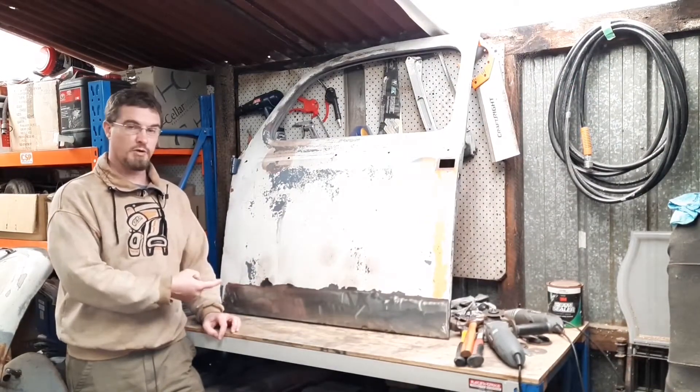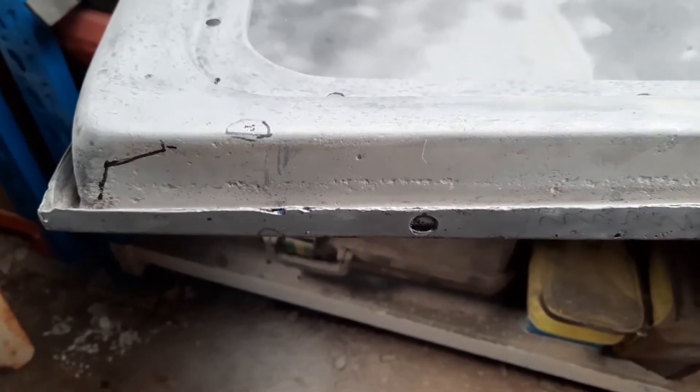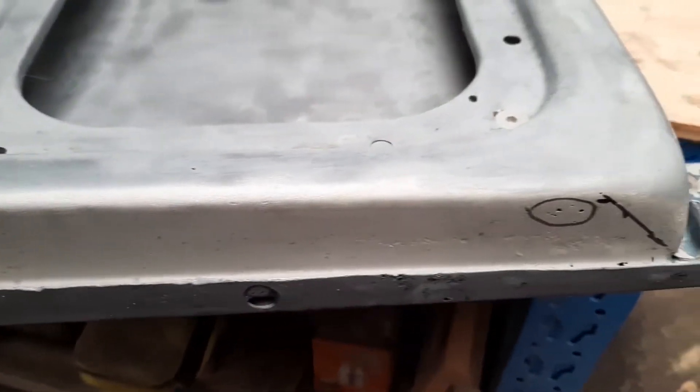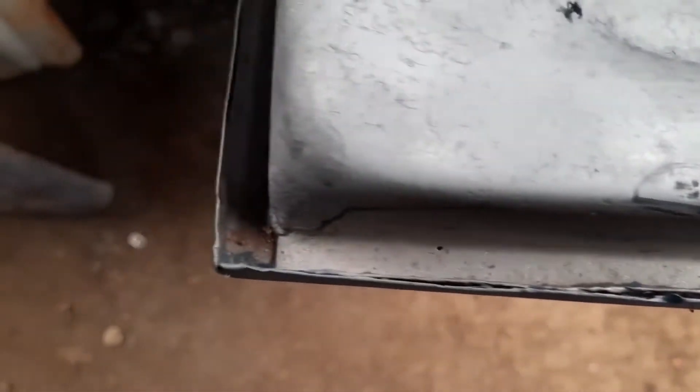First thing to do is flip this sucker over and look at the bottom of the door to show you where the rust is. Unlike the wetter states of America, northern Europe, and the UK, the rust we get here in Australia is nowhere near as severe. But you can still see a line of pitting where the rubber seal for the bottom of the door has sat and eaten in. What you can't see is the inside of the panel — it's had 50 years sitting unprotected with moisture, so it's gone through in a few places. I'd estimate out of the 0.8mm steel thickness it's probably down to 0.5–0.6mm overall. The main reason I wanted to get in here is it started to bloom or swell between the spot welds, and there's really no way to get into that area apart from removing one of the panels to clean and treat the rust.